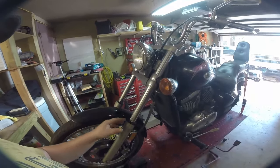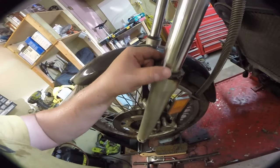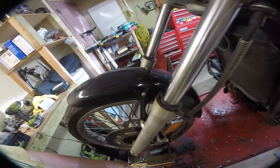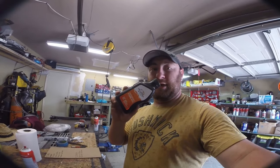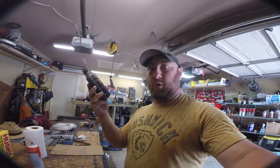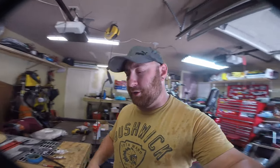As you can see, these caps are pretty worn — there's some oil on the shaft and this thing dives into braking pretty good, so we're going to address all those things. I'm a heavier guy, pushing around 260–270 pounds, so I like to use Screaming Eagle performance Harley fork oil. My local Harley dealer sells it really cheap — about six bucks a bottle. You can use whatever you want; I like to use something heavier weight, like 20 or 25 weight oil, which helps balance out me being a bigger dude.